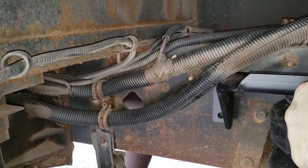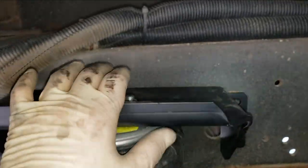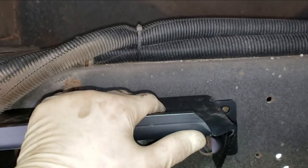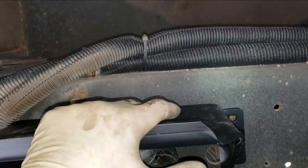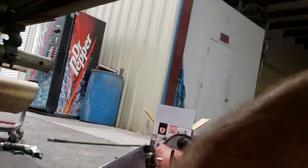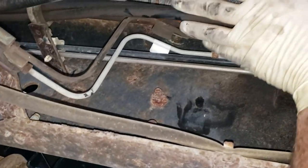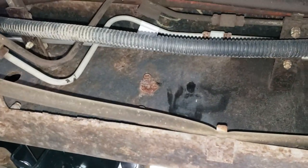This actually doesn't seem like that bad of an installation. I'm going to go ahead and drill right there, get one bolt started, then make sure that both sides are level to the frame — that'll give me a good baseline for the other side. Of course, before you actually drill all the way through you should always check the other side and make sure you're not going to hit anything important, like wires, brake lines, or fuel lines. On this side it looks like we're going to be okay — nothing in the way. Let's drill these holes and get this bracket installed.